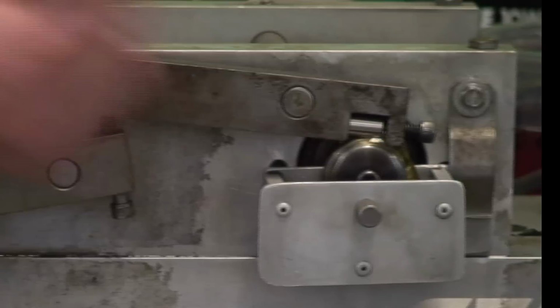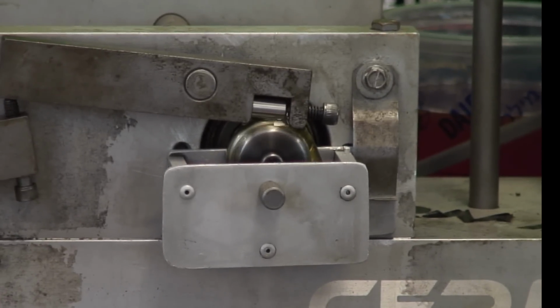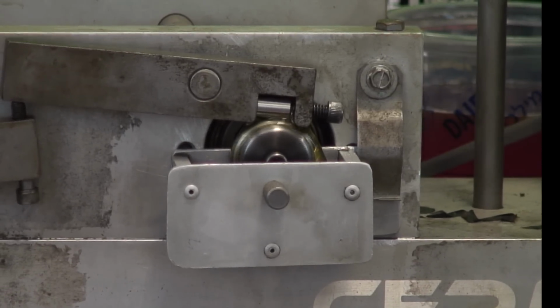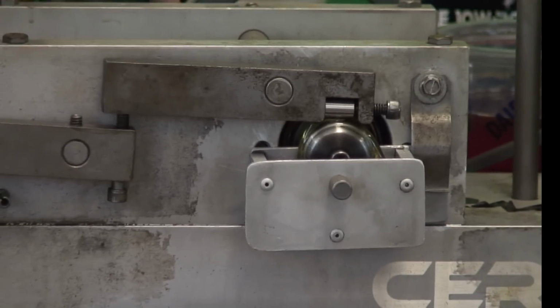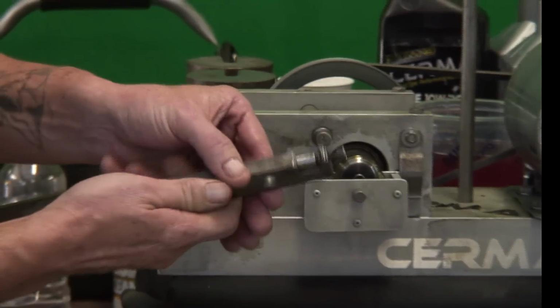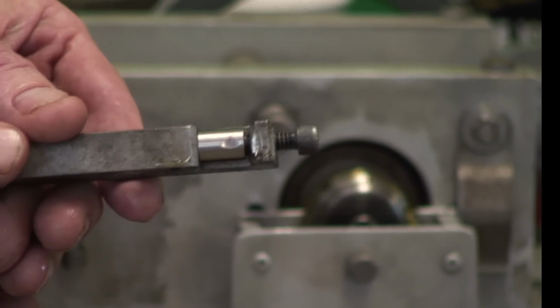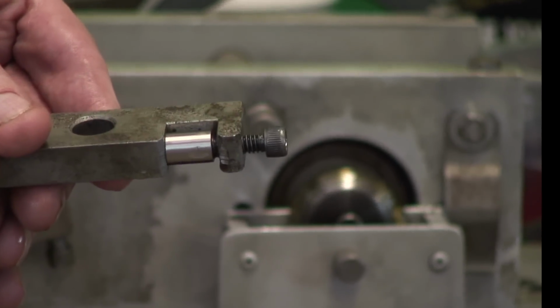Okay, so we're not going to put three weights on this, as you can hear. Two weights right here. Mobil 1, best oil out there supposedly, and it's just getting torn up. So let's now take away the two weights, take off the specimen, and show it to you. Here's the damage that Mobil 1 did on this bearing with only two weights.